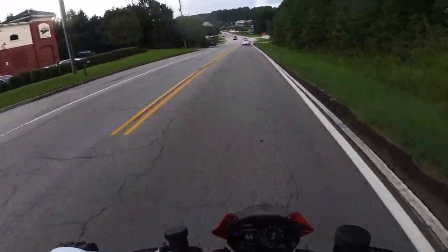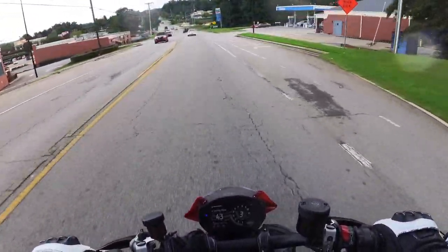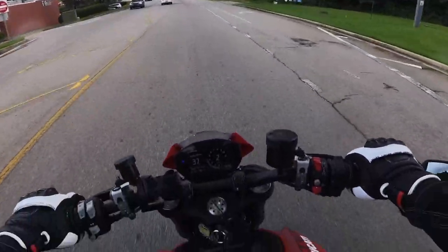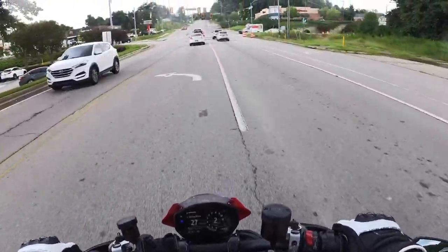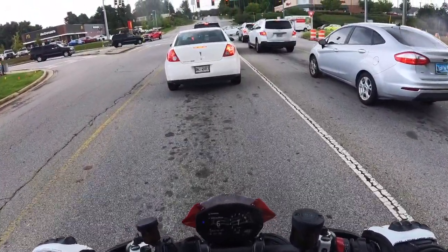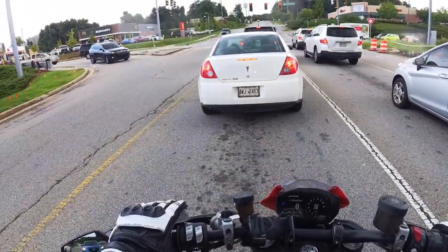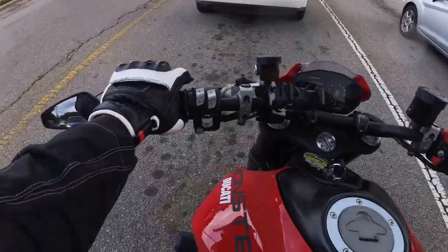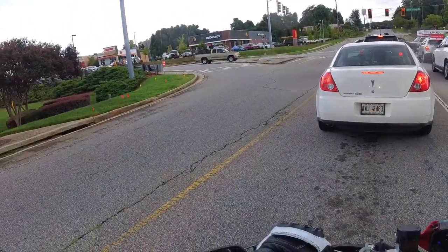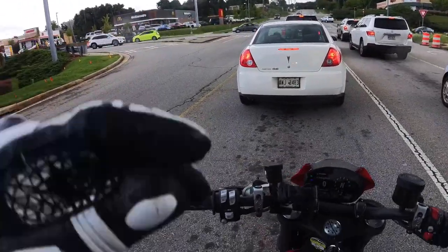The other thing I would say is the suspension - it doesn't feel bad. The damping is okay, but it's non-adjustable in the front, and I think the back just has preload. The brakes are a little... not pulsy, but there might be something on the brake pads. I noticed it grabs and releases a little bit. I don't feel any shimmy, I don't think it has any warped rotors. It might be just when they polished it - sometimes they get a little bit of polish on one part of the rotor.